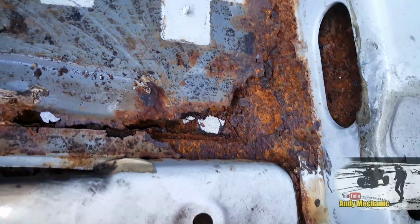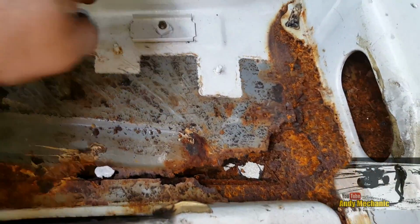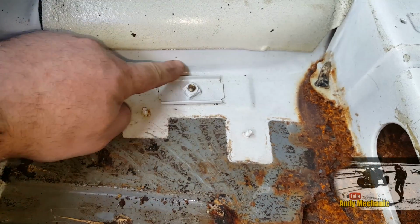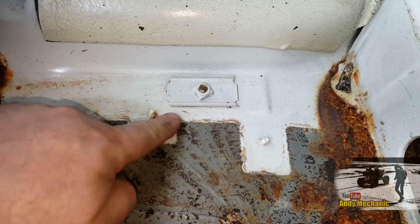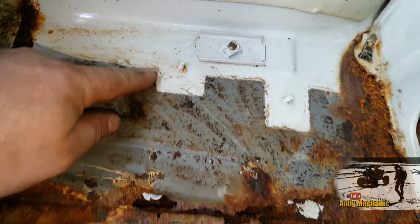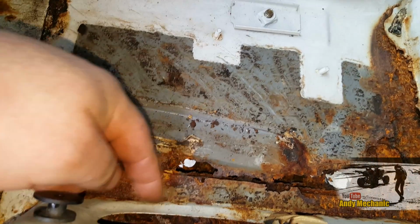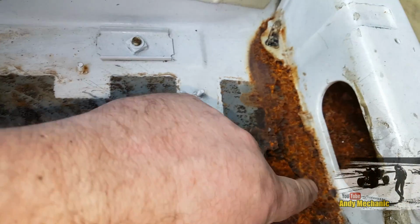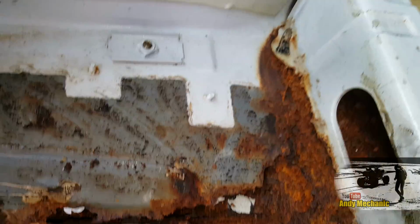This other one, I don't think that's quite as difficult. We're going to be running across the back here maybe, or maybe even across the front, so we can avoid disturbing that. I'll grind these little bits off, we don't need those. Bring it across here to about there, bring it down, and we're going to have to weld top side of this bracket and again top side of that. It's a bit dodgy to be honest, isn't it, Steve?